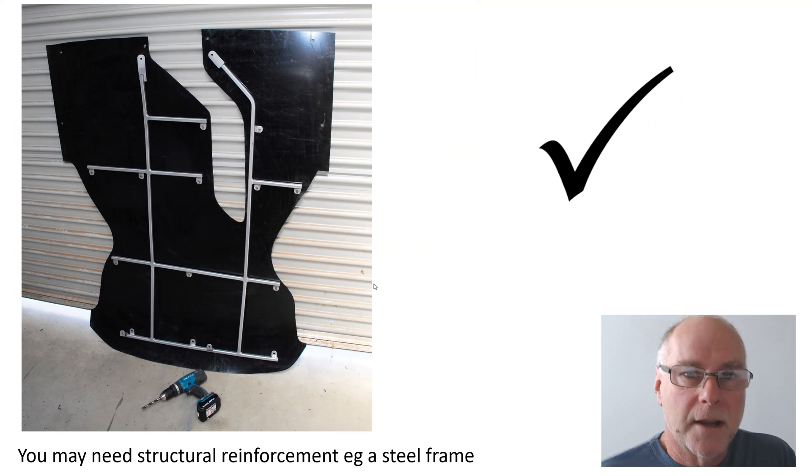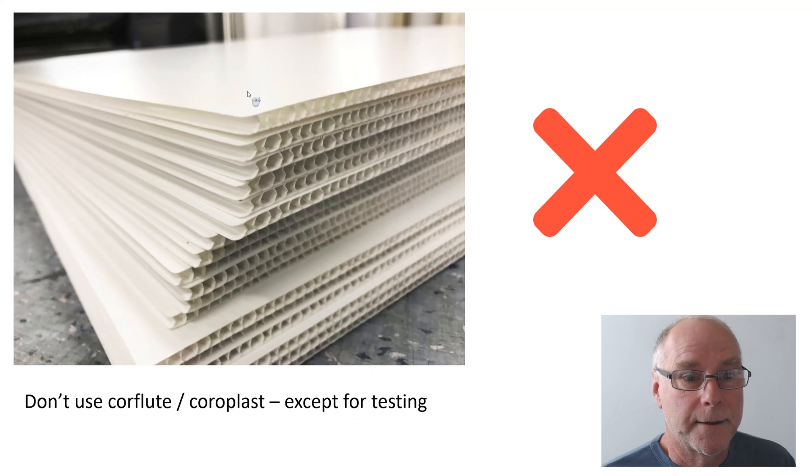Here's where it becomes more complex than many people first believe: if you are bridging large gaps you may well need structural steel reinforcement. This is a steel frame I've welded up for the rear under tray on one of my cars — made of square tube welded together — needed to support the under tray in its correct shape. You don't want the under tray deformed by aerodynamic forces. Don't use core flute or coroplast unless you're just doing a mock-up test; as a permanent installation this material is pretty weak, gets impacted and torn by rocks, so I'd steer clear of it.